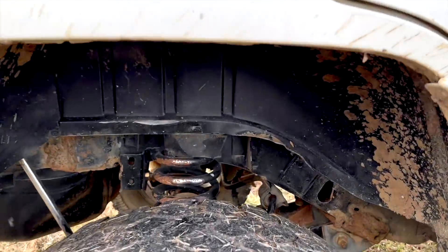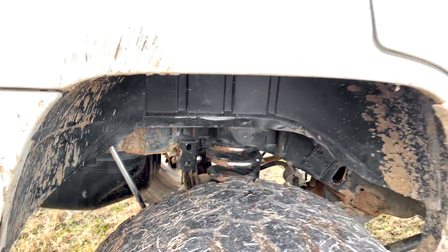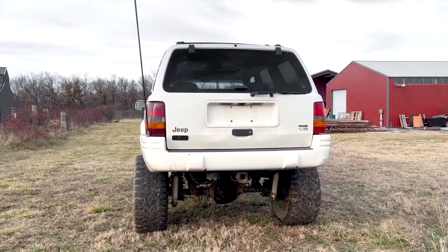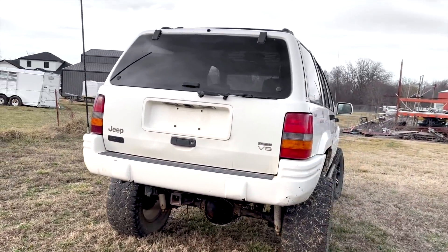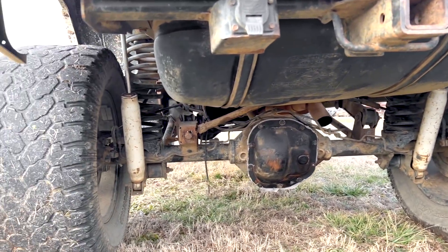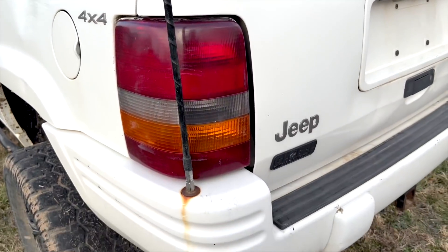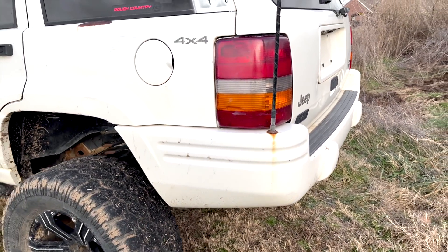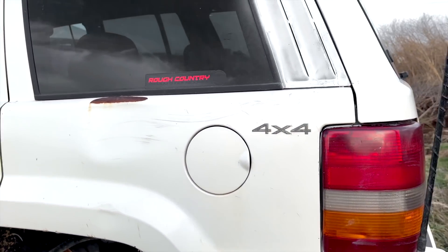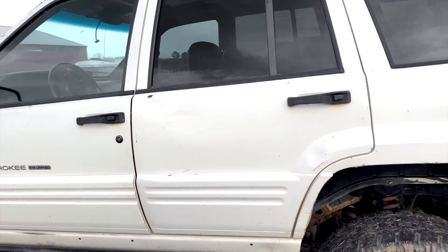The back fenders look good. There's no rust on the unibody itself. As we get to the suspension, it's really janky — all that's gonna have to be redone. But as far as the unibody goes, it is fairly clean. Coming around back, you can see a few dents, but there's the factory paint on the rear bumper as well. We've got the 44 in the back since it is a 5.9 V8. We've got some lines hanging down — brake lines, vacuum hoses, that kind of stuff. They do have a CB antenna mounted here, it's pretty wobbly, probably gonna pull that out. And on this side we've got a big dent. I think we can pull that out and then fix the surface. They painted it the same paint they used on the bumper and the vents.